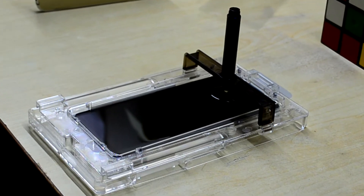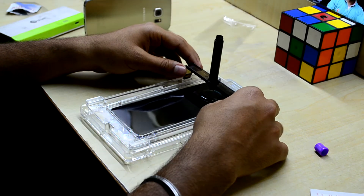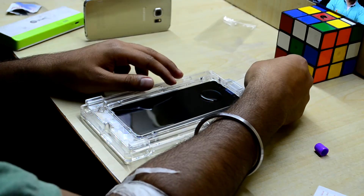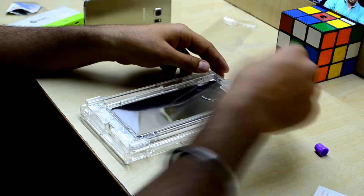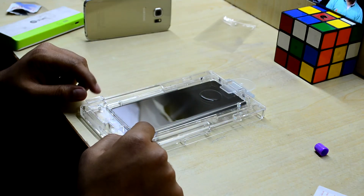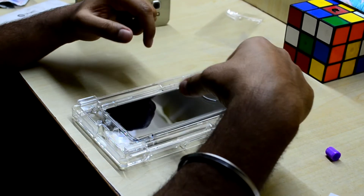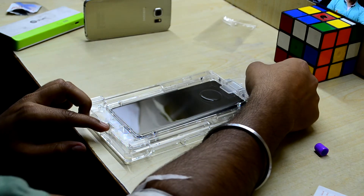Let the glue flow out for 30 to 40 seconds — it's really important to get all the glue out. After waiting about 40 seconds, remove the bracket and set it aside, then insert the plastic clip at the top where the sticker was installed. Now grab your screen protector, remove the second pack and any stickers, carefully place the screen protector down to the front, and press down on it. The glue bubble will slide down, and when it reaches the center of the display, remove the top clip.